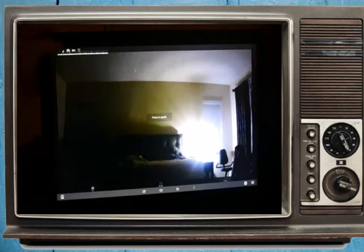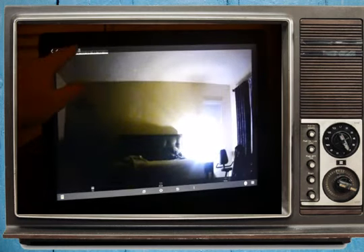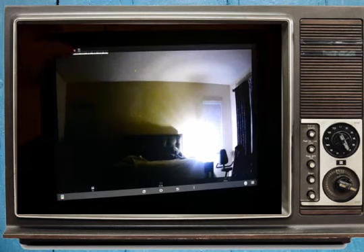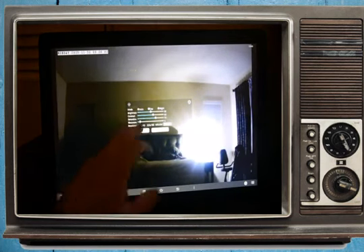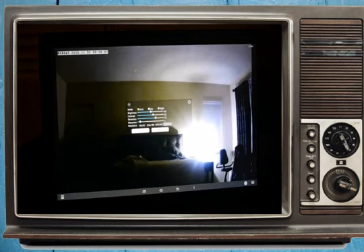It picks up all that kind of cool stuff. You can take a picture — it just took a picture of the action going on and saved that to the micro SD card. You can record a video; it's recording a video right now. You can see my arms waving. You just press it again to stop it. In the settings, you can record in auto, day, or night mode. You can also switch the resolution: 160x90, 320x180, 640x360, and up to 720p, which is 1280x720.